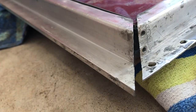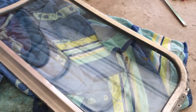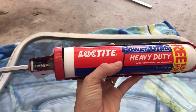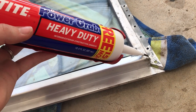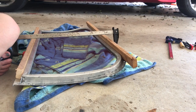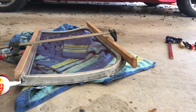We are on weekend three of the window repair and we're almost done. I got the screws in on this side, but on this side the original screws had to be drilled out so the screws aren't really gripping the way we were hoping. So instead we're going to use this Loctite power grab heavy-duty construction adhesive to seal that seam together, then rivet it into the Airstream shell before it has a chance to pop apart. Spoiler alert: this did not work. We ended up having to put screws in anyway, and with the addition of the caulk it did sort of hold long enough to get up in the frame.